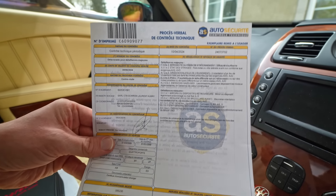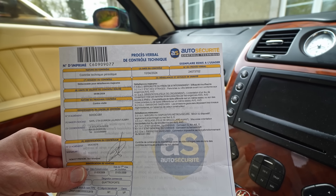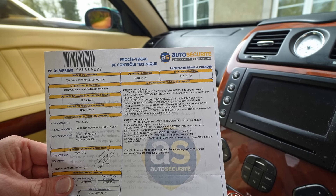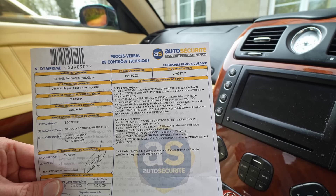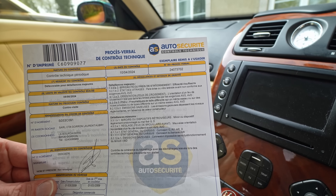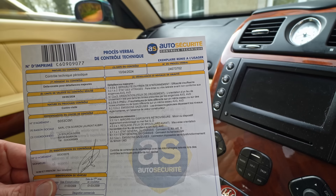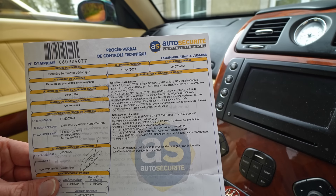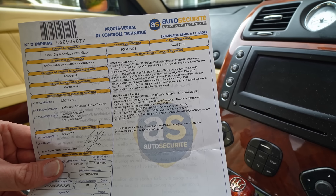There are some things in there which I completely get. Parking brake is insufficient — it's fine, it's been sat. The headlights are not in the right direction — you can see, right-hand drive in a left-hand-drive country. It has odd tyres on the front — they've got to be the same make and model tyre on each axle. The emissions are out. Window tint film. And there's minimal corrosion on the chassis — that's fine, but I've got a ramp, that'll get sorted.